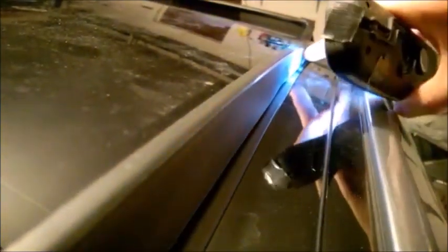The seal is no longer flat or straight, so it won't stay there and needs to be replaced. I think I know what the problem is - on the right side of the front panoramic glass, the plastic trim is simply not straight. You can see that gap there, and there's another one here. The plastic has become bent a little bit and was catching on the seal.